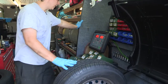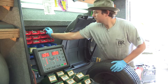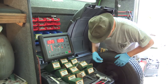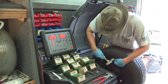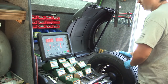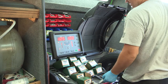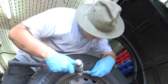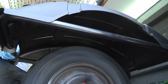Now it's asking for 1.25 ounces and one ounce. I'll grab my one ounce weight and my 1.25 ounce weight for the inside. This is all lit up here, so I know this is good. I'll grab the weight and smack it on. Then I'll spin it again until I get to my one ounce position, grab my one ounce weight, lock it in, find the top of the tire, and clamp it on. I'll spin it and check that my weights were put in the right place.